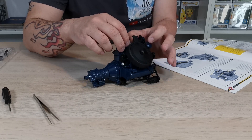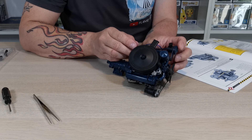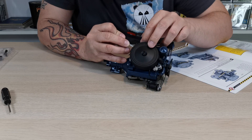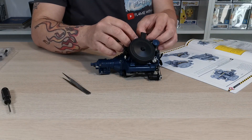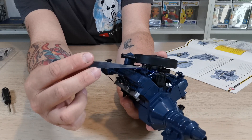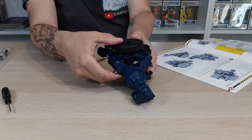It's saying to have a bend in it and for it to go through the first hole. Then another fiddly section - it has to go on to that furthest away pipe. Concentration face on - it's now in place. So there's the first spark plug lead, going all the way from the distributor cap through that first hole all the way down and onto that first spark plug. It's on there really well.